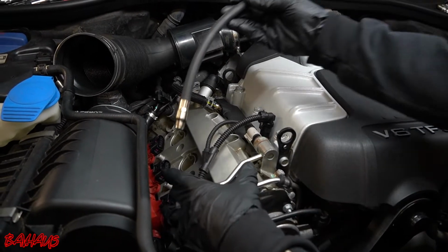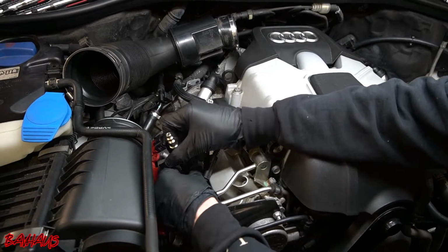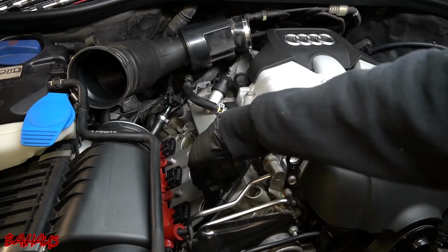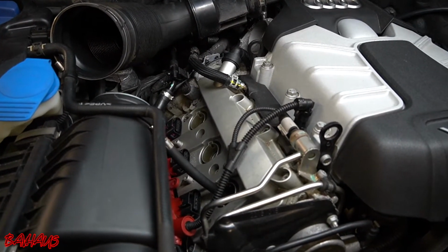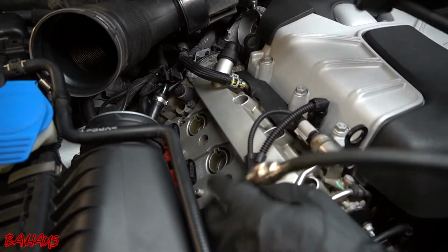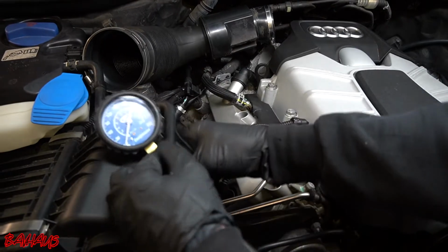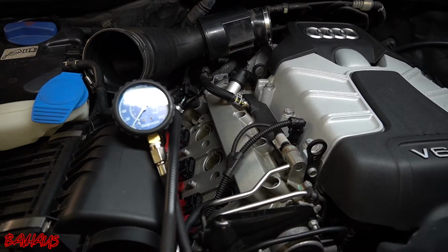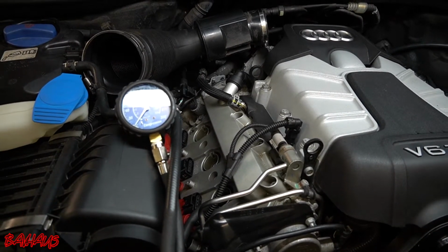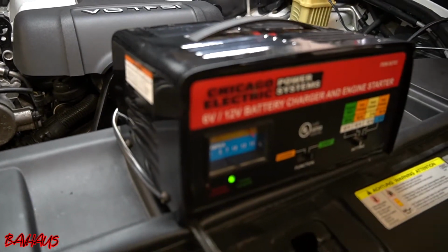All right guys, so now we got you back on the passenger side head. We're gonna start with cylinder 1. So that's the cylinder all the way up front. This is actually cylinder 1 now we're talking about. Make sure it's nice and tight. Again, not too tight. Connect your disconnect, give it a tug, make sure you're good. Actually, you know what I'll do this time? I'll tuck it under here so it can't run away. There we go. So, I'm gonna plug my jump tool back in because I disconnected it for a second. I'll go inside, and start cranking.